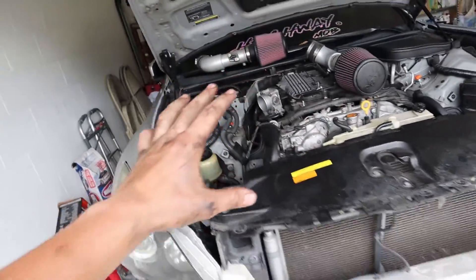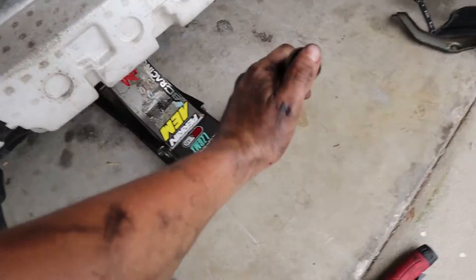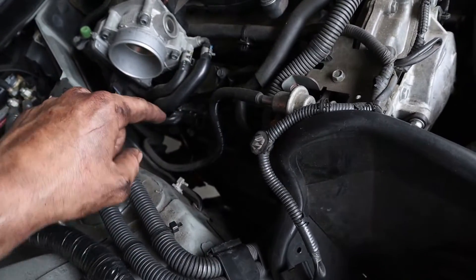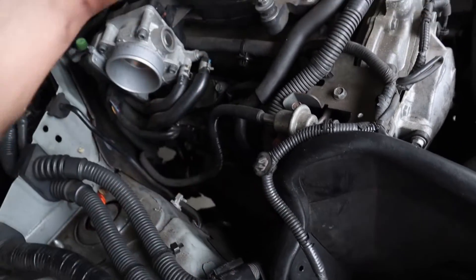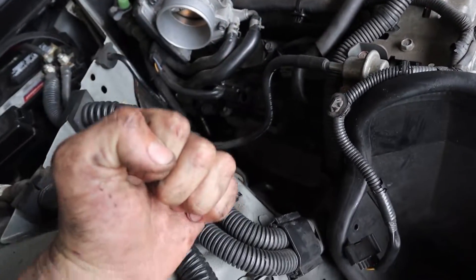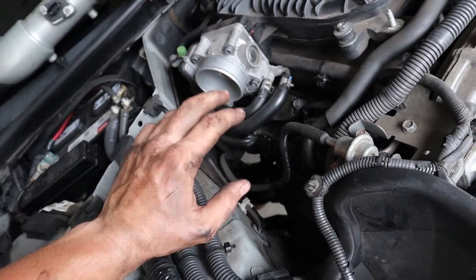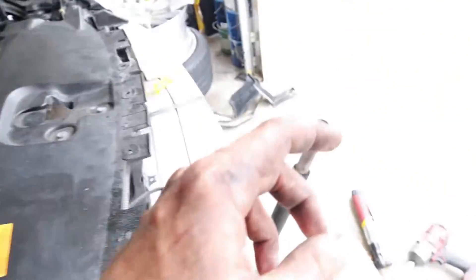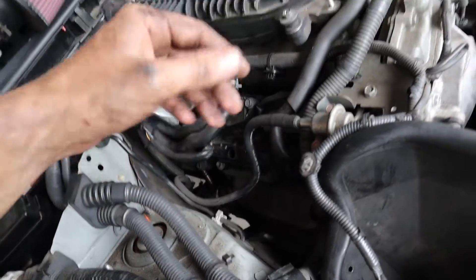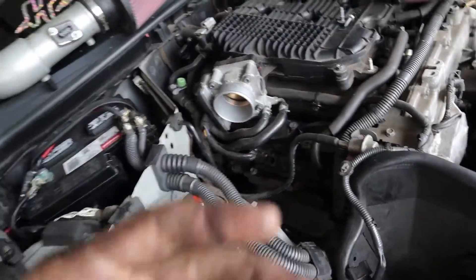Also, food for thought. I took this off and actually put it in right here to brace. So with the extension sticking out all the way like this, if you go to try and loosen it, basically all of those extensions are going to pull and twist and you're not going to be seated on that bolt correctly. So especially because that's padded, I stuck that down in there and it basically gave the extension something to lean on, so that the extensions were as straight as possible. And I think that's also why it made it so much easier to break.